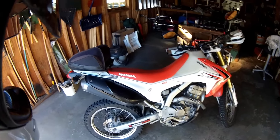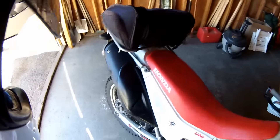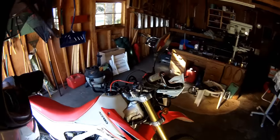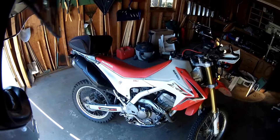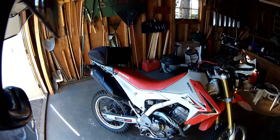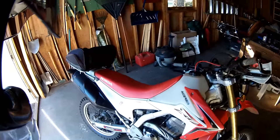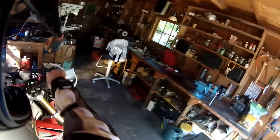This is the stock exhaust the way I have it. No doubt the Yoshi is going to be a lot louder, and that was part of my objections to having an aftermarket exhaust. But I've been overcoming those objections — I'm just getting tempted to see what it's like. Quite frankly, the stock exhaust is getting louder by the month anyway, because it has packing material in the outer shell — it's a double wall outer shell — and I think that gets clogged up after a while and doesn't deaden the noise, so it gets louder anyway. So there you go.